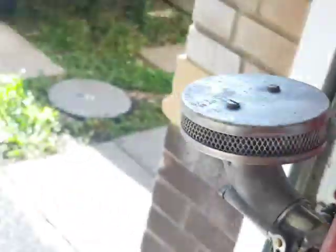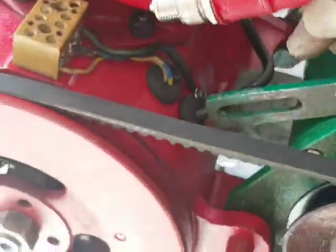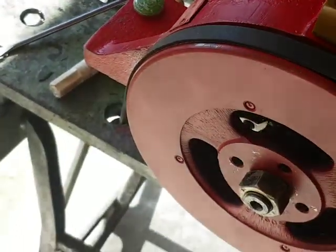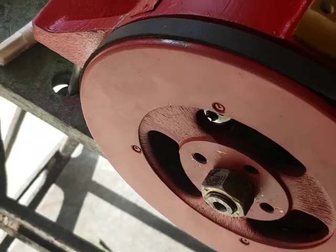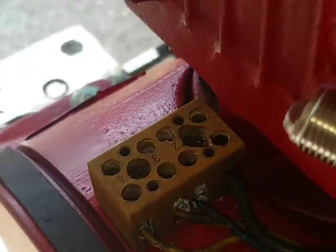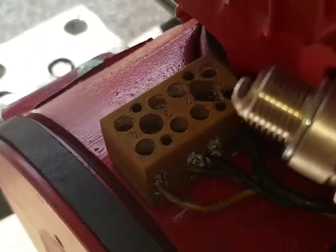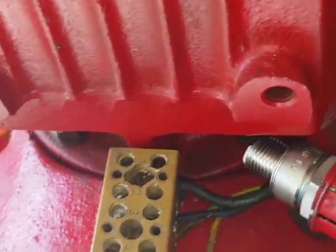So if you're testing this in reality, I suggest you do it at your own risk. Lay the spark plug along the adjuster slot of the belt or somewhere near the front of the engine touching a bolt. If you don't want to risk getting an electric shock, use a cable tie to tie the spark plug so it's touching the chassis on the outside, and then you can freely rev it over and see if you've got a spark. You also won't see the spark if you've got bright sunlight.